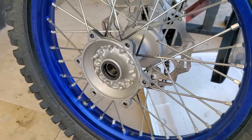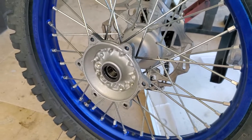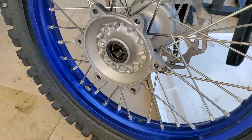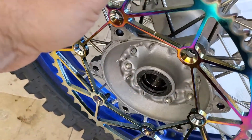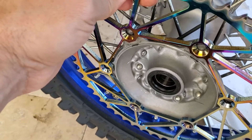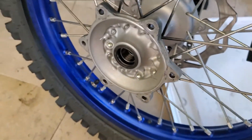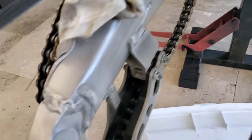I skidded to a stop a couple of times thinking maybe my toe is resting on the brake, maybe a branch caught some grass, maybe there's a stone in my brake system. Finally I got off to check it, and lo and behold my sprocket was rattling — I was missing two of my six bolts and all the remaining bolts were loose. It literally moved an eighth to a quarter of an inch.